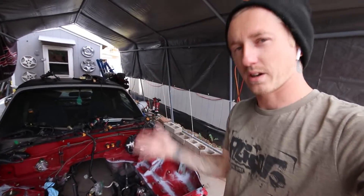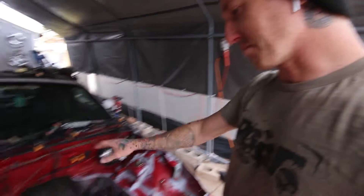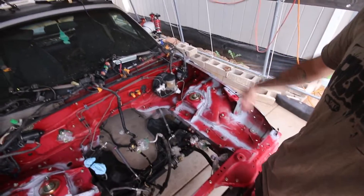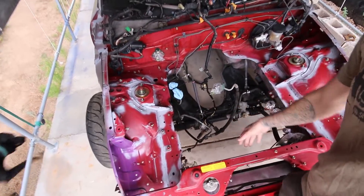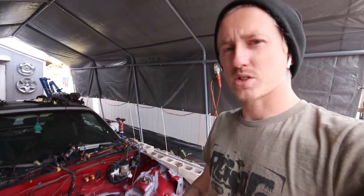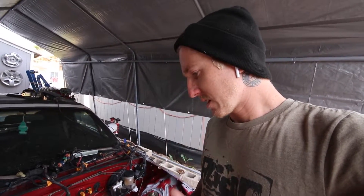Two days later — I went on a little drive yesterday just to get away from the car. I tested with some purple I had laying around, didn't really like that shade, so I found some darker stuff. I gave it mostly a scuff with 320 and 400 grit along all the rough spots I could reach. I bought some aluminum foil to start masking — wrapping it around — and for the condenser I'll tape some cardboard. The subframe I'll cover with a trash bag.